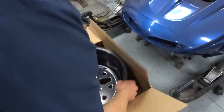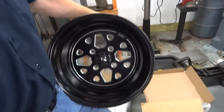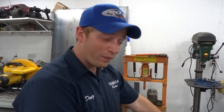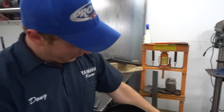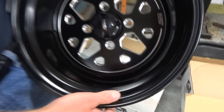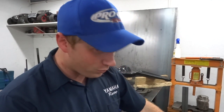It looks like these rears are a bit wider. That's a 10-inch wide wheel on the back. Finding 10-inch wide wheels for these things is not all that easy — not that many manufacturers make them that wide. I had 8-inch wide on my Maverick with the same size paddles, but talking to some guys that run the wider 10-inch wheel, they claim there's a significant difference in flotation. Stepped up and paid a little bit more. Hopefully, it's worth it and we can get the tires mounted. Should be better than the old Rockabillies.